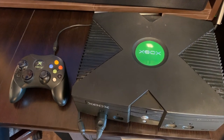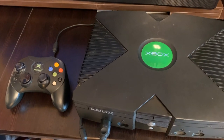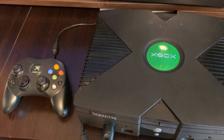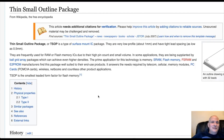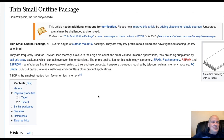I'm going to show you how to TSOP flash your original Xbox with a version 1.2 to 1.5 motherboard. TSOP is just an acronym for Thin Small Outline Package. In today's terms, that's just a fancy way of saying flash memory. The Xbox uses a TSOP for what's called an electrically erasable programmable read-only memory, or an EEPROM. You can erase data from it and write new data back to it — it's not permanently burned. It can be written to over and over, kind of like today's modern flash memory can.